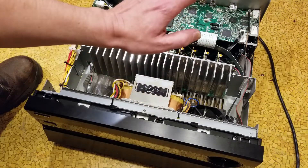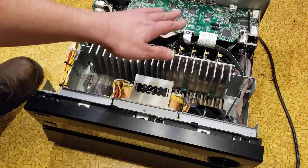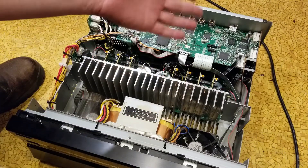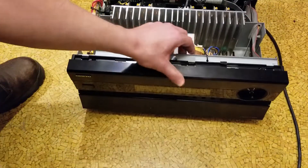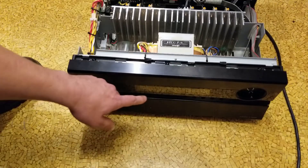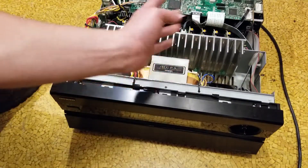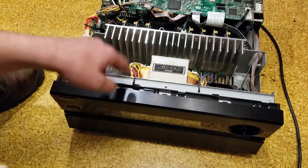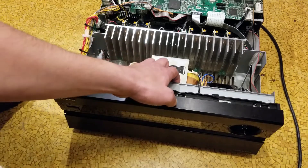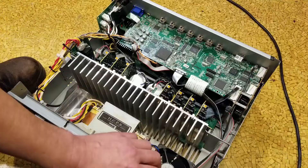Onkyo over the last decade has had a variety of issues with chips and thermal fatiguing. It happens in computer graphics cards too — there are tons of videos on BGA reworking. That's the issue here. This receiver has the infamous problem: it seems to turn on and work fine, clicks twice, interacts fine, except the speaker grid array isn't displaying and there's no audio output, even in pure direct mode. Research online points to the DTS/Dolby digital decoder chip as the culprit.